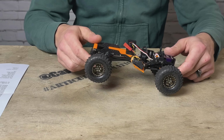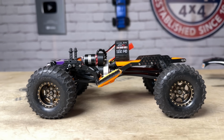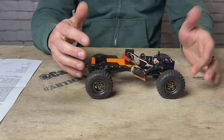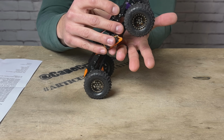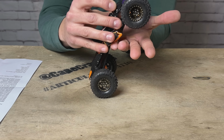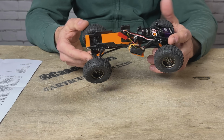Crazy angle on this thing. He doesn't say exactly what the angle is. We've got to say that's like 12 degrees. We're in the age of extreme angled skids on these things now, but the advantage is that when you stand up to go up against a vertical obstacle, you have that much more room before you hit your links. So you can get your chassis right up tight, and then your wheels, you hook up and go. So it's very advantageous to have these extreme angles in here.